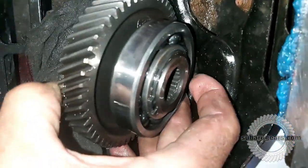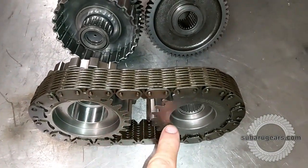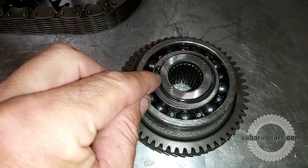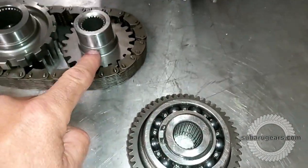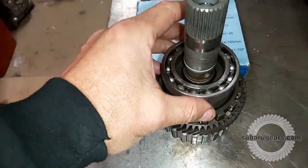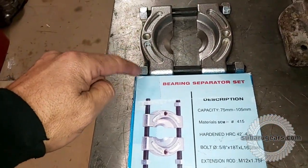You can see the gear that's been removed has the bearings pressed onto the gear and shaft. The drive gear spins the other drive gear, so they spin in opposite directions. We replace them with a drive sprocket, a driven sprocket, and a chain, so they spin in the same direction — this essentially spins the pinion in reverse. The driven gear has a circlip retaining its bearing, and we want to transfer that bearing and circlip over to our Subaru sprocket. We'll use circlip pliers to undo it, then press the bearing off and press it all back onto the sprocket. We used a bearing separator plus our press to separate the shaft from its gears and bearing.